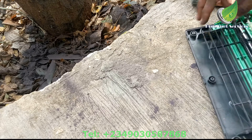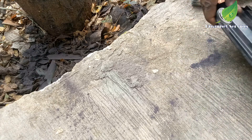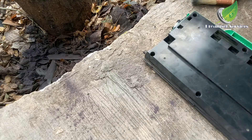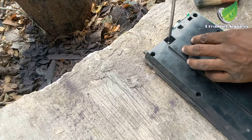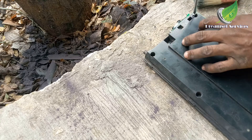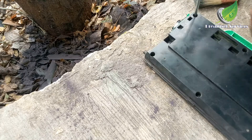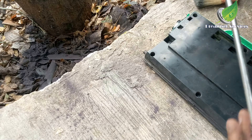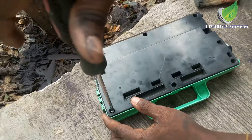For people that have the issue of the WT box full error — to correct this issue you have to reset your WT box. Look towards the handle at the top of the WT box and if you look closely you will see two metal contacts touching each other. What you have to do is separate these metal contacts from touching each other, because when the two metal contacts touch each other, it sends a message to the printer that the WT box is full. Separate them and that will resolve the issue.